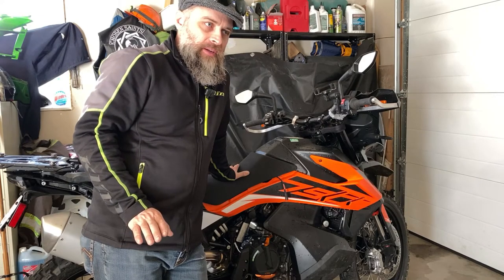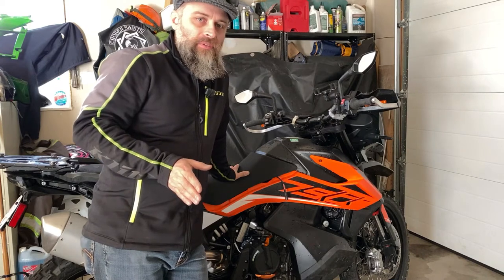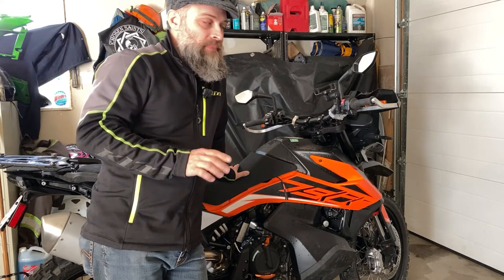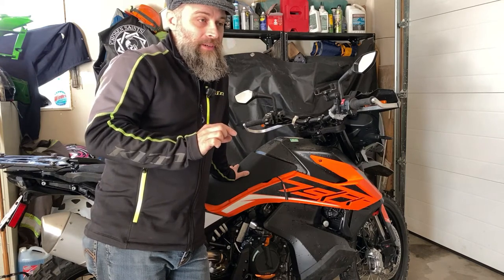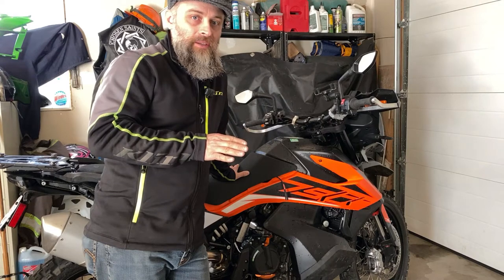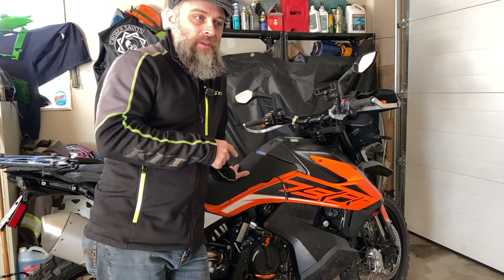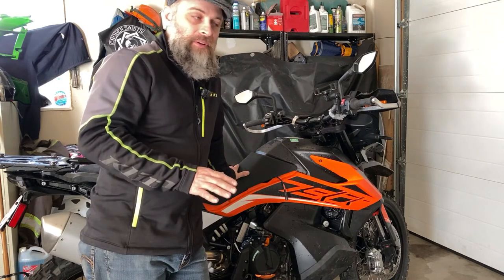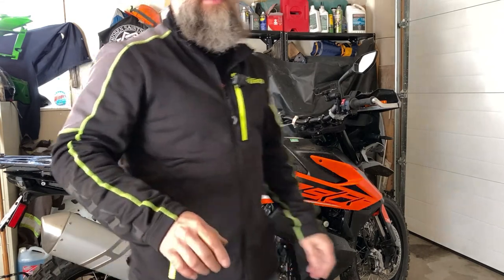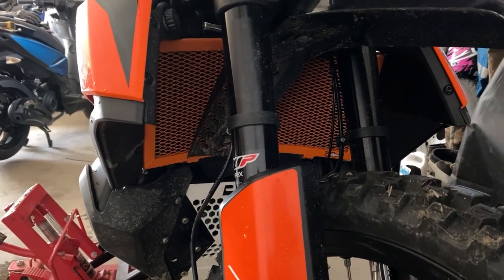Remember how I said I was going to go on a little ride just to make sure the coolant evened out? Well, that little ride turned into a 350-mile jaunt of adventure riding through mud and everything. So it's definitely settled out — we got all the air out of the system. I checked my level and was just about bang on; I added maybe another 100 milliliters or so. Now it's judgment day. I'm going to fire it up, let it idle just like before, check the temperature for when the fan kicks in and how long. Same temperature gun, same ambient temperature as before — everything the same other than a different rad guard, which I don't believe should be a major issue. Alright, let's start this experiment.